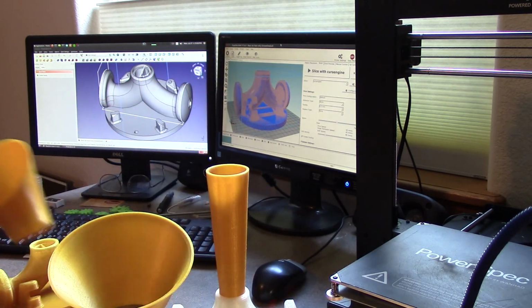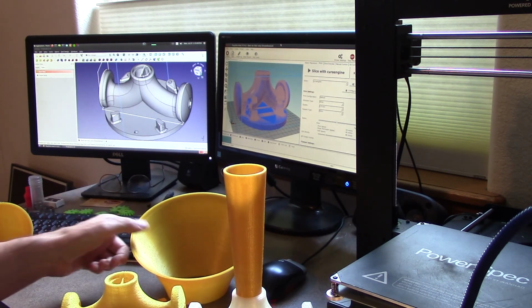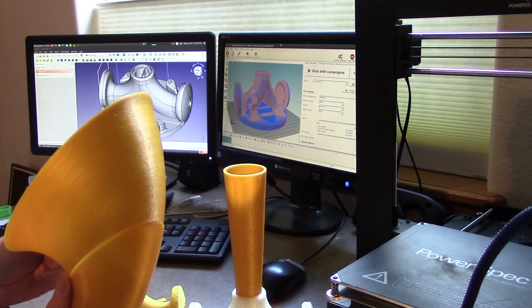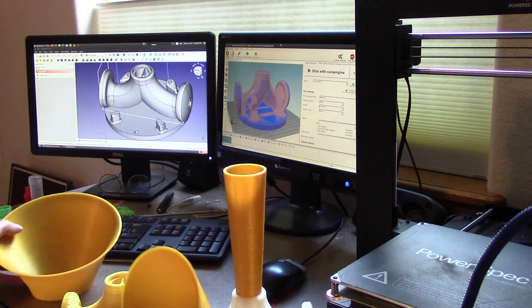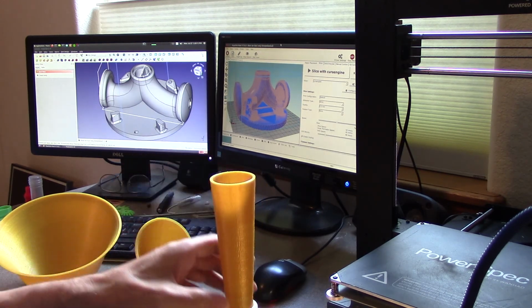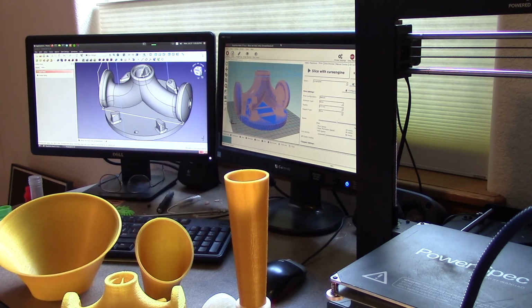You look at these ads in these old early 20s radio magazines, and I still keep thinking it's optimistic, but maybe it'll work. I mean, the whole idea is you're not getting something for nothing. This is basically an impedance matching device. It's basically what a horn cone speaker is, an exponentially expanding cone. So if you can shepherd and organize the pressure wave of the sound just right, you can actually get the most out of your meager amount of energy and deliver it to a usable space where people can hear it, hopefully. At least that's the thought.